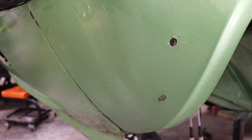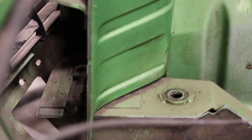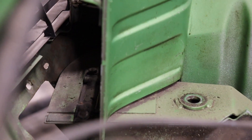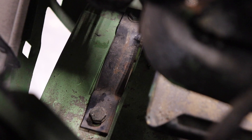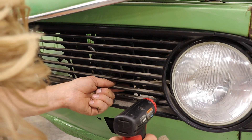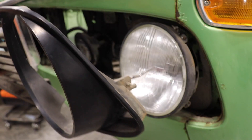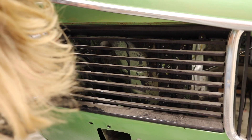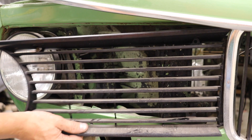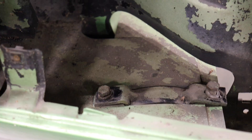We'll have to drill a hole there. We'll be reusing the big hole there as well as an extra hole where those two bolts on the plate are — we'll need to remove that as well. To do that, we'll have to remove the grille, four screws, and then there's a little plastic knurled nut on either side that holds this aluminum hook. Do this for either side and voila — decent access to those little plates.